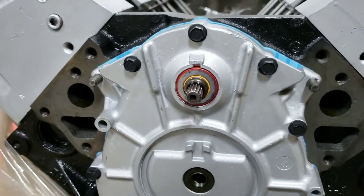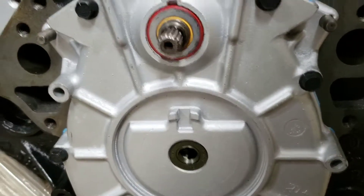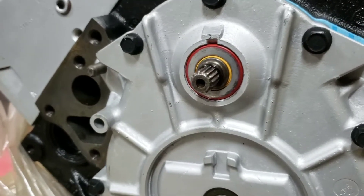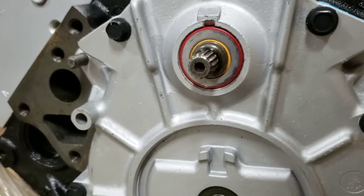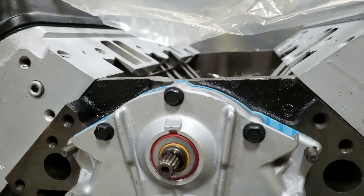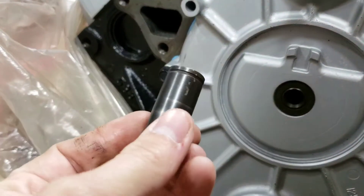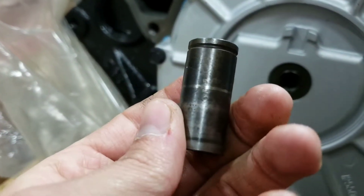I just figured I'd make a quick video because I've seen a lot of people put those on there wrong and they don't really know the difference. I don't know how that is down the road, whether that causes problems or not. But I'll throw up a picture here from my factory service manual - it does show that there's a correct, right and wrong orientation of this, and it shows that that little collar goes towards the engine.